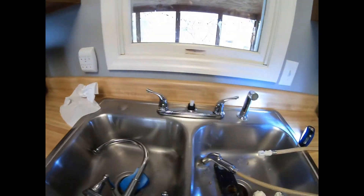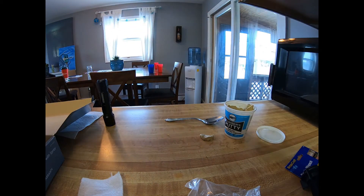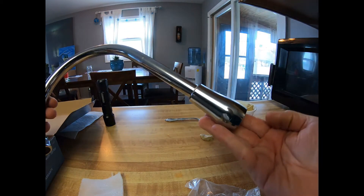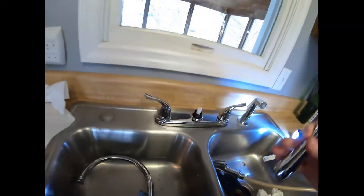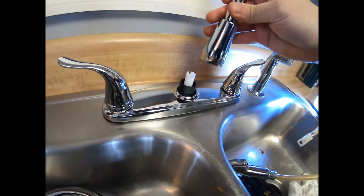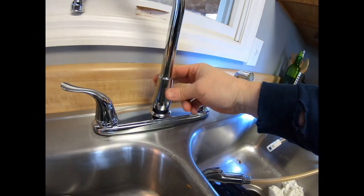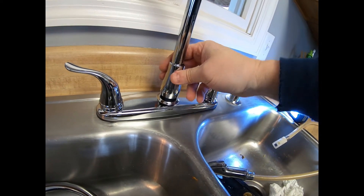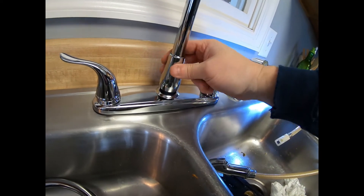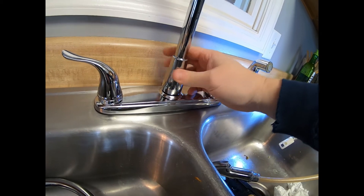This piece goes down in here — that's good. Now we're going to install the new neck. Here's the other piece — see it goes in here and seals right around that. Just take this, push it straight down on there where the threads are. Now this here you actually turn — be careful, it should go on easy. If you feel tension too soon it means you're cross-threading it and ruining the plastic threads. This one lined up perfectly — just keep turning it until it's all the way on there.